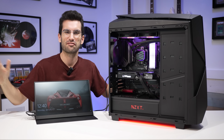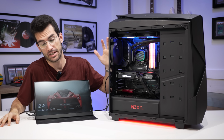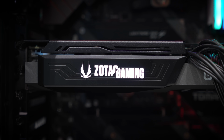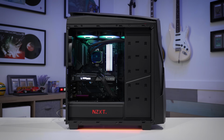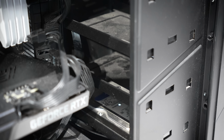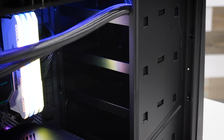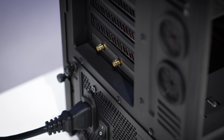Hey, would you look at that? Fired up, no problem. All the lights are spinning. There was one fan that I forgot to reconnect. That's why we check these things, the rear fan here. So that has been wired back up. Everything's spinning, everything is lit that should be lit, and we have our post. Now, the fans are very loud, you can probably tell, coming through the mic here. I'm going to calibrate his fan curves in the BIOS after we migrate everything over to the new case.